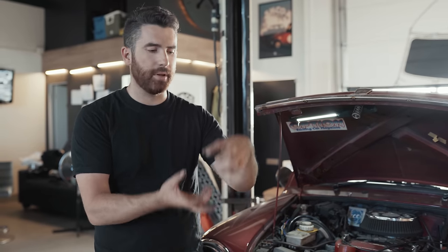They have a really simple, either the steel tin can or the white plastic can. It looks similar to the clutch master cylinder, just a single line. The single line feeds the entire brake system. What this means, though, is if you get a leak, that single master cylinder, if it leaks out, there's no secondary system for that. So from a safety point of view, a twin system, dual system, is a lot safer.